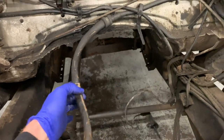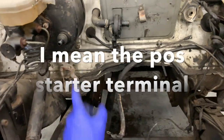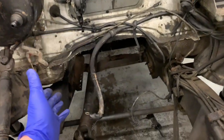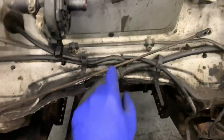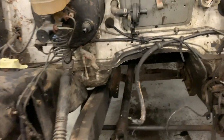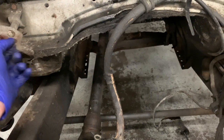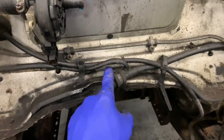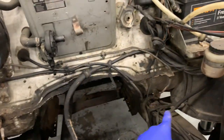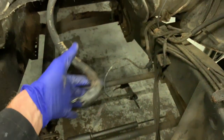This is the battery terminal, and that battery terminal is on the wrong side because the starter on the 617 is on this side, the 606 is this side. So we're going to literally take that off that P-clip there, take that off as well because we don't need the throttle rod anymore, it's going throttle cable. You can take all this linkage system off because you're not going to need any of it. Take that 10mm out of there, move your battery cable to the other side so you can put it onto the starter motor this side, and you've got your exciter wire and your starter wire. As easy as that to go straight on.